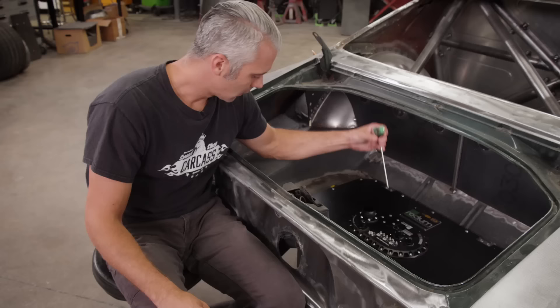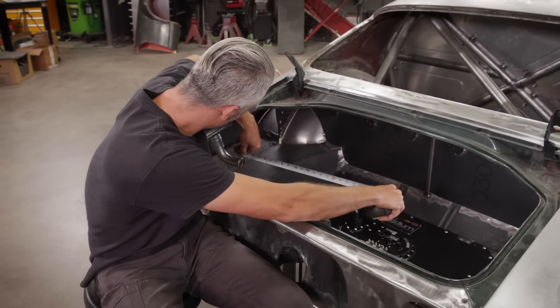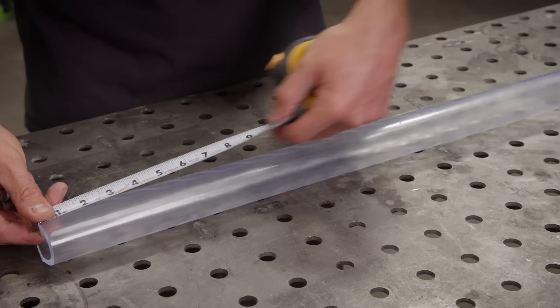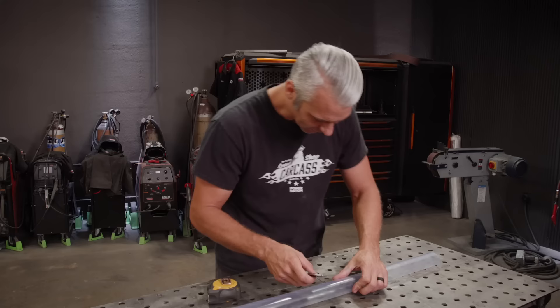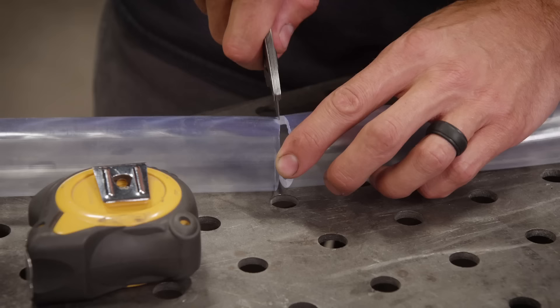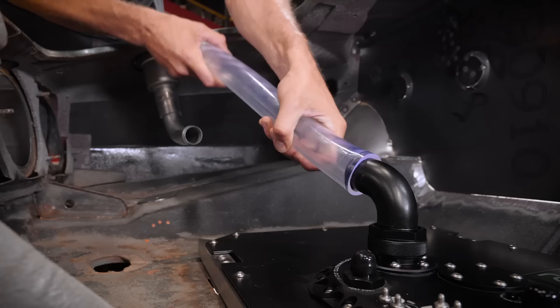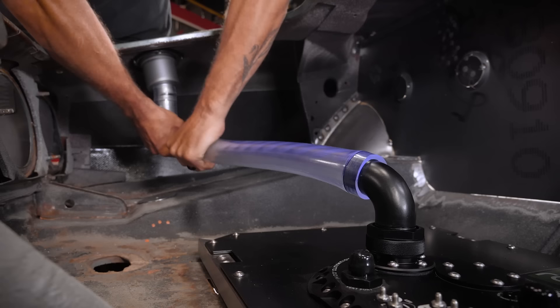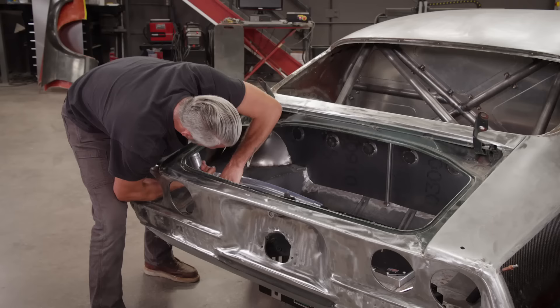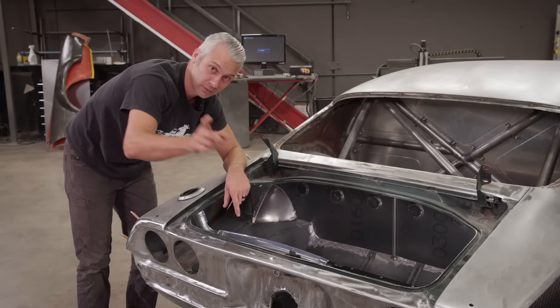We'll go ahead and add the adapter on top of this piece, then pull a measurement from here and cut our tube — that's going to be 19 inches. This is just all mock-up, super easy to install. We've got good drop on everything. Radium makes some really nice products, and this will work perfect in our Camaro. We'll call this all wrapped up here, go grab a couple more things, and finish out the back end of the car.